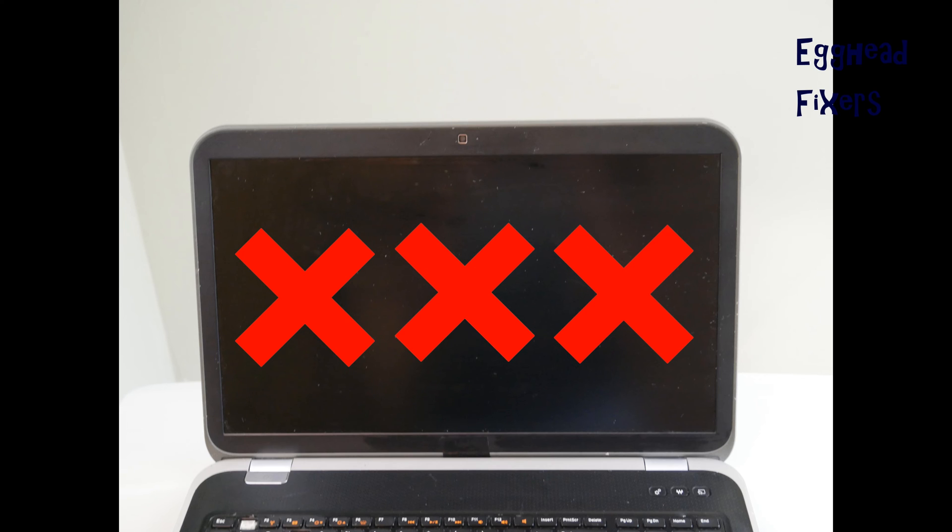If that doesn't work either, the next step is to try replacing your CMOS battery. It's less likely than a RAM issue, but it does happen. Refer to the video linked below, which shows how to perform a BIOS reset by removing the CMOS battery. A failed CMOS battery can cause these kinds of display issues, so replacing it is the next logical troubleshooting step.